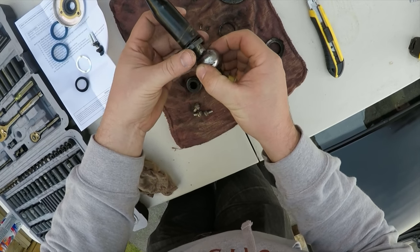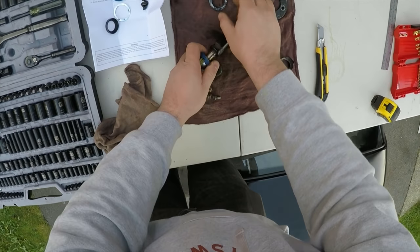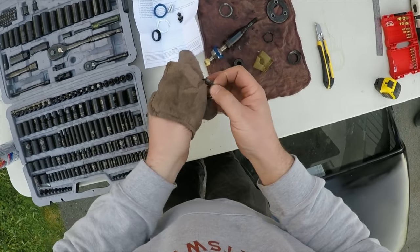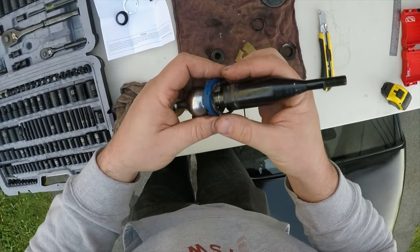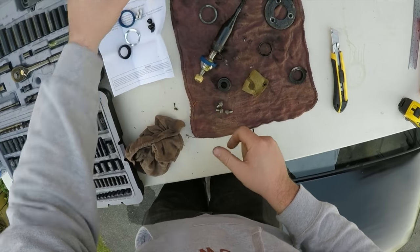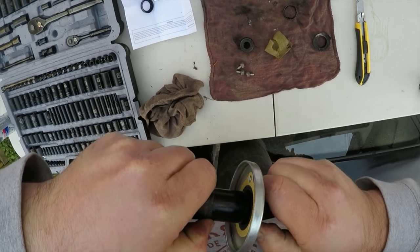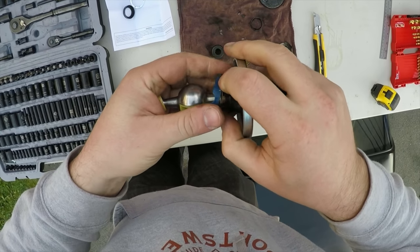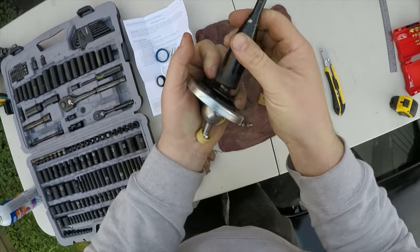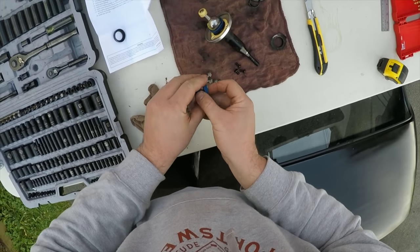Remove the rubber bits and the plate slides over top. Then you've got the upper seat bushing. Clean off any debris, place the upper seat bushing on, and reuse the spring plate off the old upper seat bushing. Apply some lube to the inside of the new seal and a little on the shifter shaft itself — it will slide down over top. It gets a bit rough where there's debris but just force it over and it will reseal. I'm going to reuse the original 10 millimeter head hardware rather than the Phillips head screws that came with the kit.